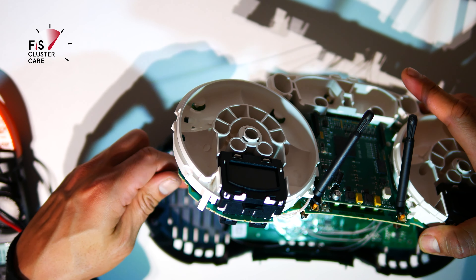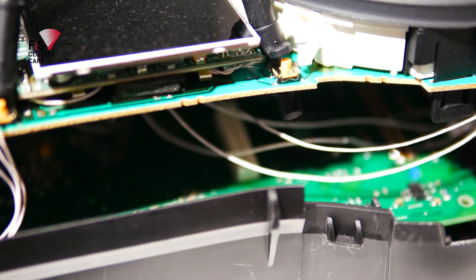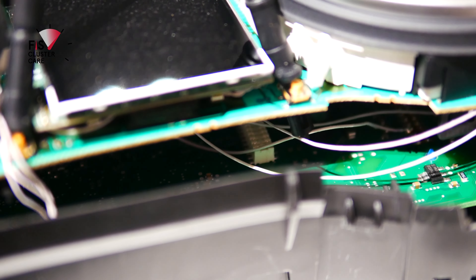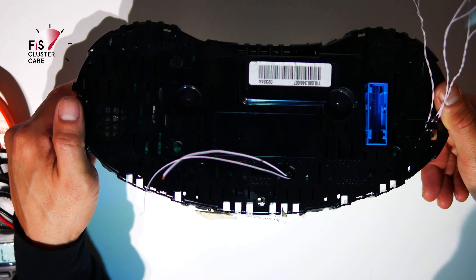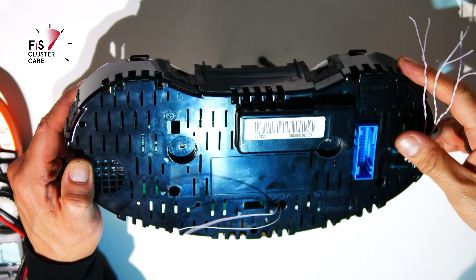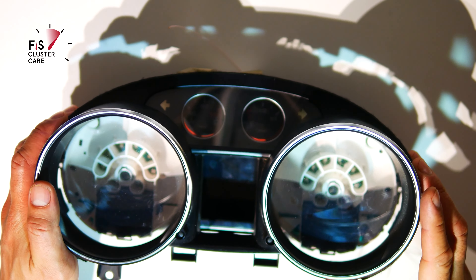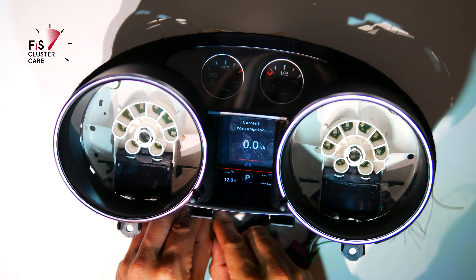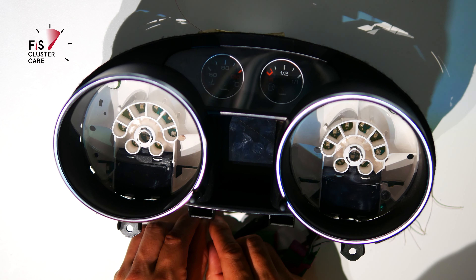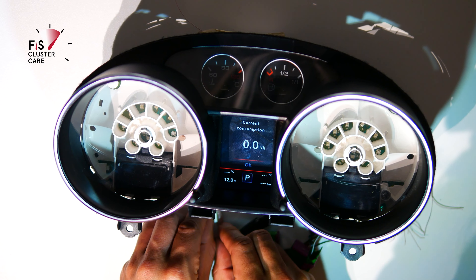With all of that done you can join the two halves together — you're more than halfway at this point. Be careful not to snag any of the wires in the two white connectors. The CAN bus wires poke out from the rear with a blue connector — add the little plugs for a conveniently removable ColorMFA instrument cluster. Test fit the fuel and coolant foil to ensure ColorMFA isn't mounted too high; it should sit flush to the foils or lower. Now test run ColorMFA — all you need is 12 volts, ignition, and ground for it to start working. It's working in the housing, so you can move forward.